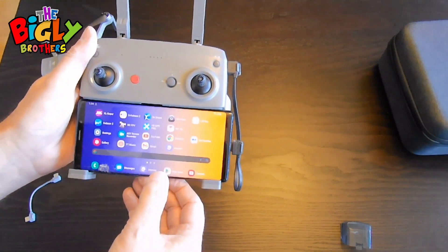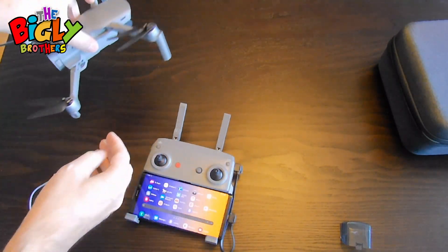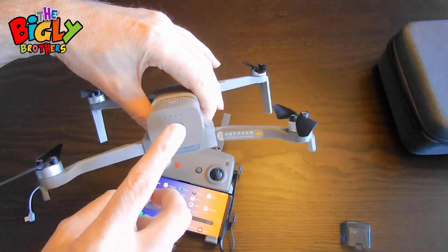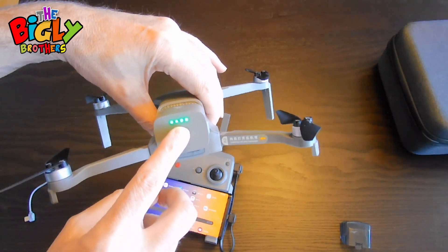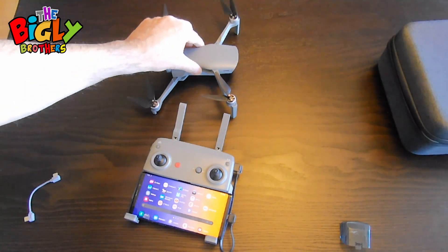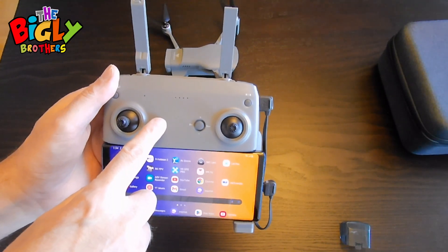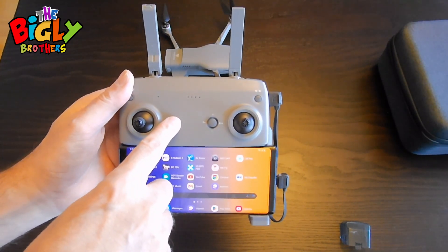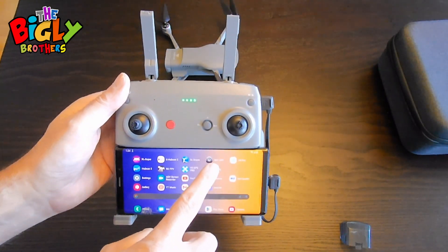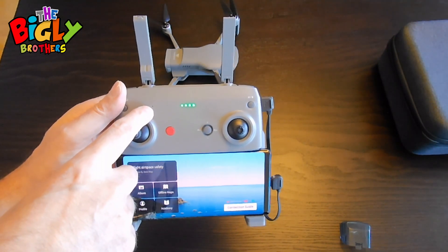It's noticed that it's connected. Next, you're going to take the drone — there's a big button on the battery. You're going to press it once, let it go, and press it immediately again and hold. Click and hold, and you'll see the lights come on and the drone chirps — that means it's in binding mode. Now press and hold the power button on the controller too. See the lights come on, then you can press WKFly and you'll see a red light, which means it's connecting to the drone.